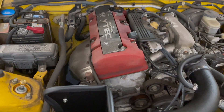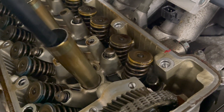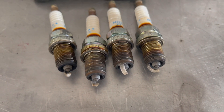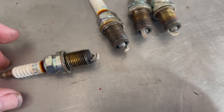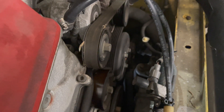We're under the hood now — we're going to do the retainers and keepers on this AP1, it's a 2002 with a nice brand new intake on it. These are the factory AP1 retainers and keepers — all of them look to be in good shape but we'll get them changed out. It's more of a preventative maintenance thing anyway. These spark plugs may be the originals — there's a good chance they are. Also replacing the belt — rotating the engine over I noticed how frayed it was, so that original belt is getting replaced with a brand new one.